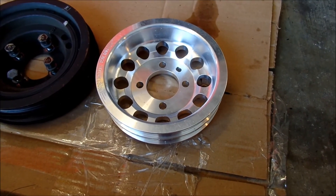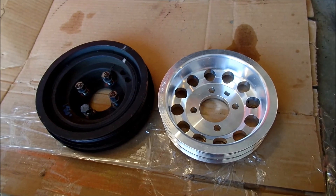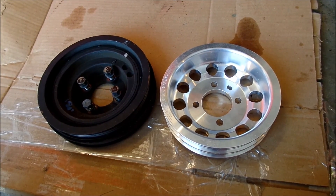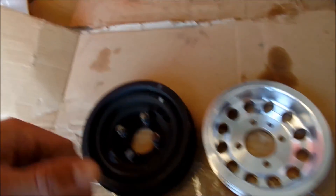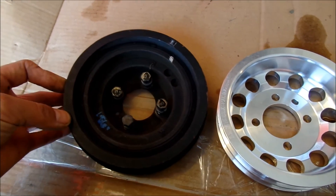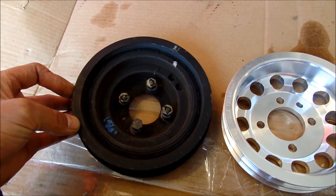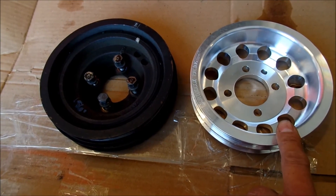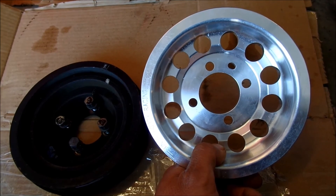I have one installed on that Eclipse right there too. I haven't had any problems with it besides my car vibrates a bit, but I think that's because I have full solid urethane motor mounts and inserts. That's an interesting thing to know about underdrive pulleys - why I prefer this over the stock one, because this is fewer things to fail.